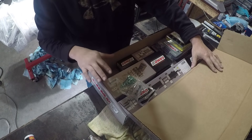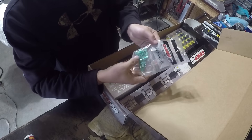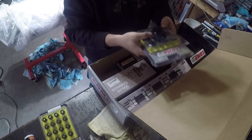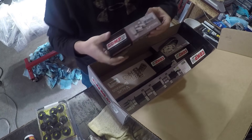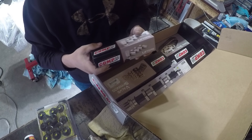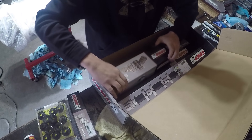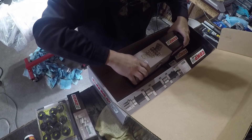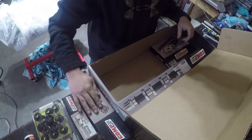Inside the kit, they had everything really nicely packed. We've got valve locks, new valve seals which we're going to be putting in — even though our heads got rebuilt, I don't know how long they sat so I'm just replacing them. We've got steel retainers for the pump cam, new lifters which we're going to soak for about two days before putting them in the engine, and new high performance valve springs to replace the stock ones in the heads.